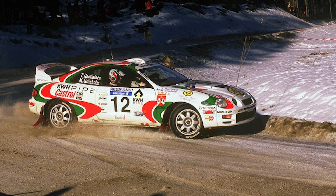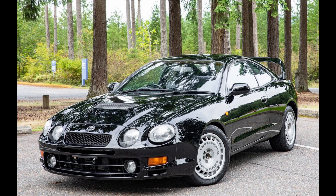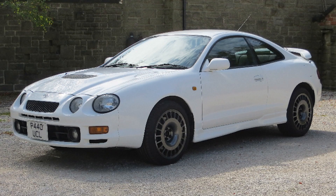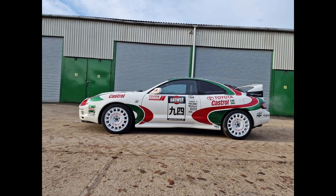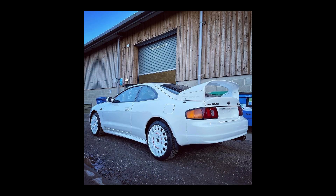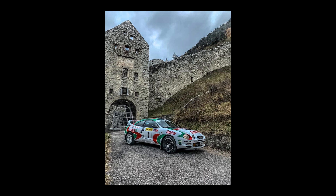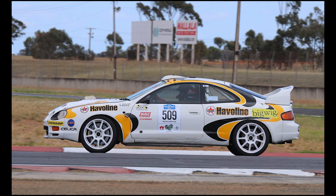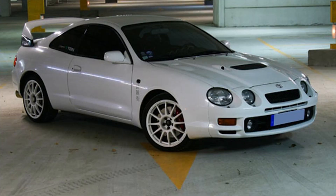The third objective is handling. I think the geometry is slightly off — when I say geometry, I think the offset is slightly different on the wheels I have right now. They're much wider, and when you have wider wheels it makes the steering slightly heavier. The Celica has heavy steering anyway, but mine is even heavier. It feels very direct, but sometimes heavy steering means you don't get as much feel through the steering wheel — the weight kind of numbs the sensation and feedback. That's my theory. So I think if I have slightly lighter, smaller, narrower wheels, I'll get a bit more steering feel coming through.